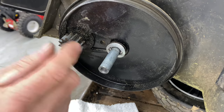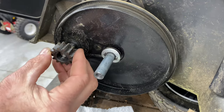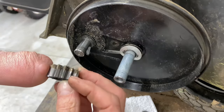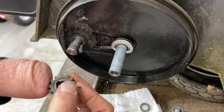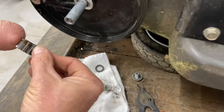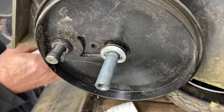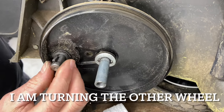If you put these gears on backwards, the self-propelled will not work. So make sure that you put them back the way you got them. Now, they call it a dog or a key — it's about ready to fall out of my hands. Remember that the dirty part on the back of this gear goes towards the back. The little copper-looking part is where nothing wore off from it running around the gear on the wheel. So just remember that copper part goes towards the back side.